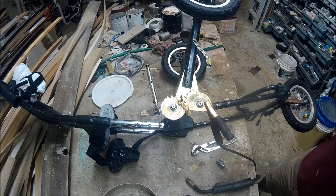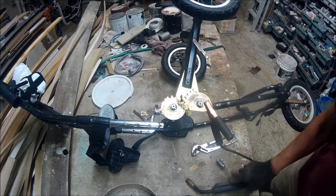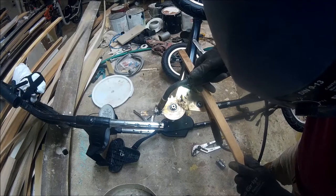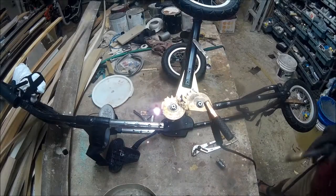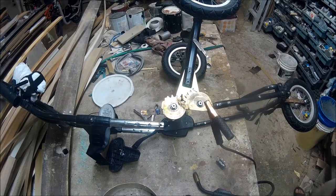I'm going to tack it, then remove the vice grip so I can complete the weld. We're basically welding a butt joint. I'm going kind of slow because you can apply too much heat and next thing you know you've blown through the metal — it's fairly soft, not real high quality, made in China. Going ahead and completing the butt joint. The wire speed is at 60, the gauge setting on my welder is 7.5, which I think is about 14 gauge, and I'm welding with .030 standard wire — not arc weld, not oxygen or acetylene.